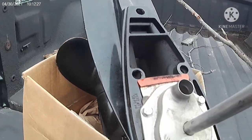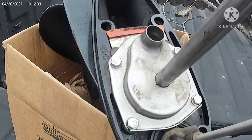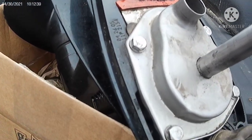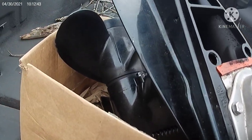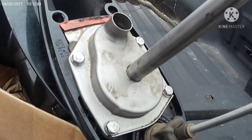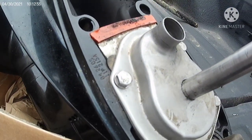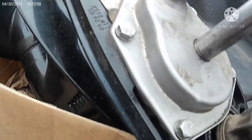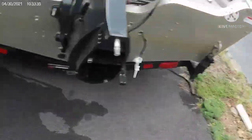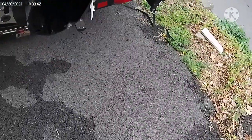I put the cover back on — that was a little trickier than I thought lining it up, but I believe I did it correctly. There's a little metal key in here that lines up with the shaft and also with the sprocket that the impeller sits on. I believe I got that on and tightened it all up nice. Now I'm going to put the lower unit back on the boat.